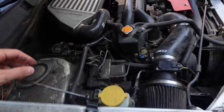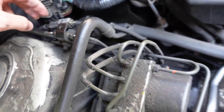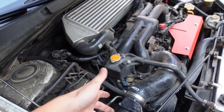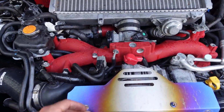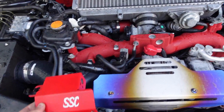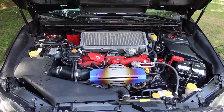I know the Legacy has a bypass right here — this connection has a resistor in it for the O2 sensor that goes to the catless up-pipe. I'm going to see if that would actually fix my issues. If it does, I'll happily delete this again because I do not want it — I want it nice and clean here, hence why I deleted it in the first place. But let's go ahead and throw this back in. It's not bad, but I'd just rather not have it, honestly.